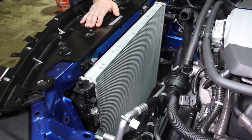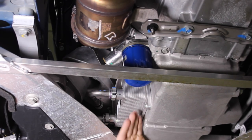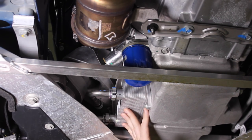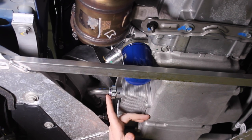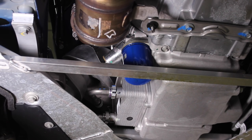If you think of it that way, it's a little bit easier. And this is the oil cooler that uses coolant to exchange heat with the oil in the pan. This sits level with the pan, so all the oil in this cooler is just sitting in the pan as well. These two fittings are for the coolant that comes into the heat exchanger to exchange heat with the oil.